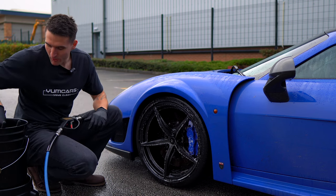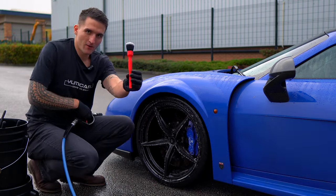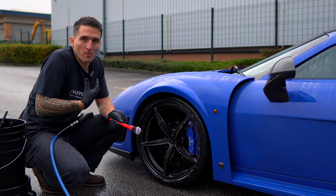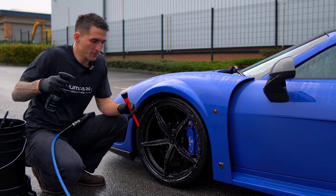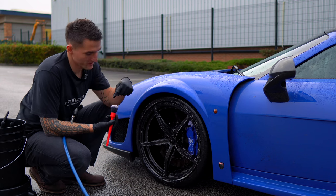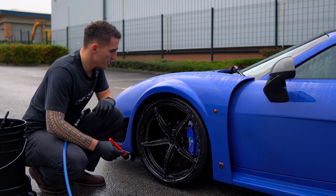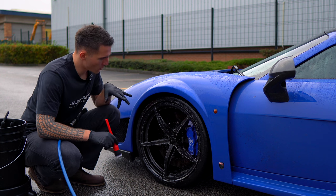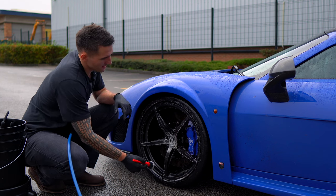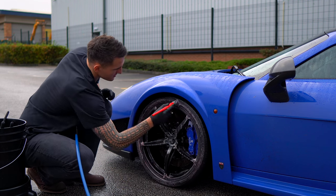So this is a two-in-one formulation working in tandem. While that's dwelling, I like to give my tools a quick rinse. I've got my Detail Factory brush here. A tip: when working on your wheel, I like to preload the brush — do one spray onto the brush so you've got product on both sides, which is almost double the strength. On your personal car on a weekly wash, don't bother. But on a car like this that's flashing this badly, I'll use that trick.